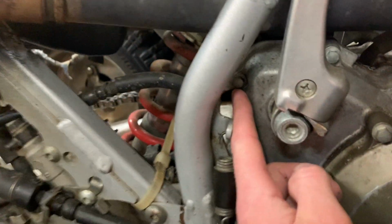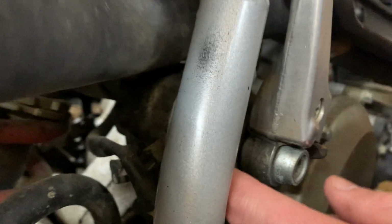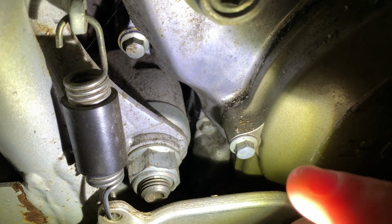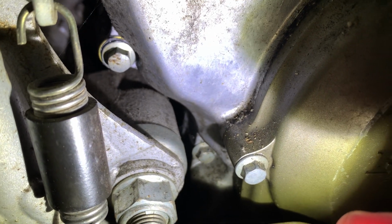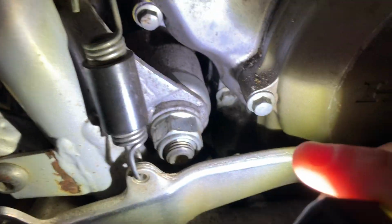because this bolt right here that you can see, this bolt leaks, and what it's leaking is clutch fluid. And when this bolt leaks, it runs down the back of the, I'm sorry, I lied to you. It's actually this bolt here, the one just below it. See, it's got a brass washer around it. That was something I was trying to do to get it to stop many years ago. I've tried RTV, I tried a brass washer. No matter what I do, I cannot get that bolt to stop leaking. The fluid is not overfilled. It's not overfilled. It just comes out of it.